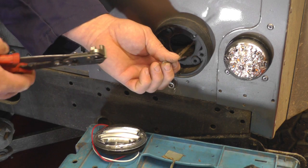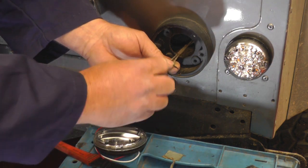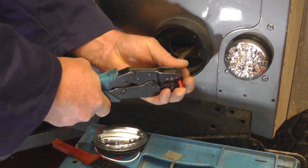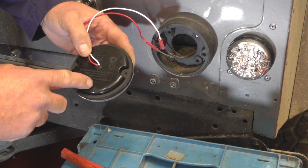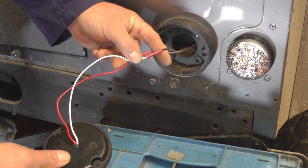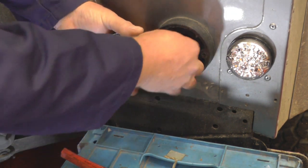We've cut the old connectors off and carefully using some wire strippers we're going to strip off the insulation and then fit these bullet connectors. They should fit on easily and we can crimp them up using the right crimping tool. On these light units it shows you on the back which colour wires go where — the negative is the white wire, and the red is the positive — so we've connected that to the grey wire and the white wire to the black wire. All we need to do now is make sure it's orientated the right way around, carefully insert the cables, and fit the screws.